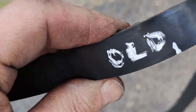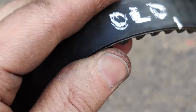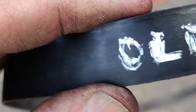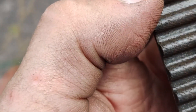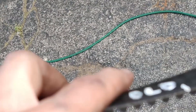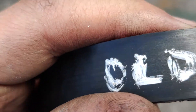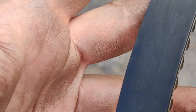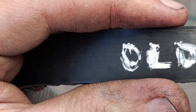When comparing timing belts, make sure you mark the old one — write 'old' or an 'O' or something so you don't mix them up and accidentally put the old belt back in. This one is so pristine and perfect I'm now wondering if the previous owner had already replaced it. Either way, make sure you mark the old one so you're not thinking you've got another 110,000 miles to go.